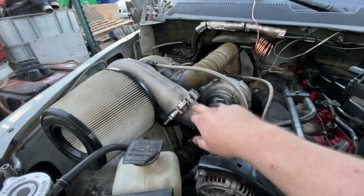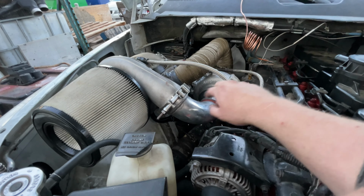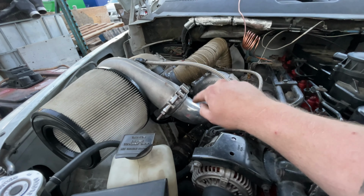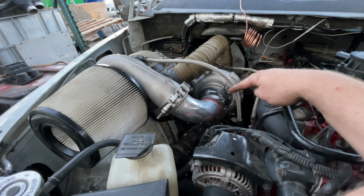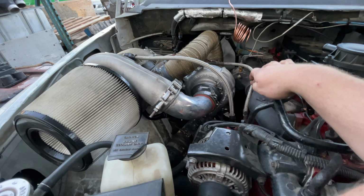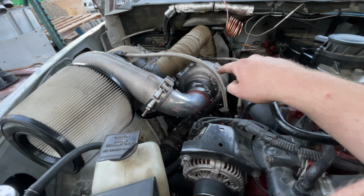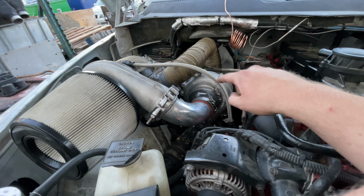So what we got from there is I had to buy this clamp and fitting. Picture right here. That is also from True North Turbos. This piece is just a tight radius aluminum 90 that I used just to keep it simple. This flange is aluminum. Vibrant 3-inch to 4-inch, 2 band clamps. This is the original oil line on the K27. This is the original oil line to the truck, so that obviously didn't cost anything. The K27, I think they're around $1,450 Canadian, a ballpark.